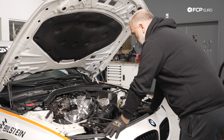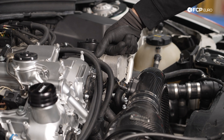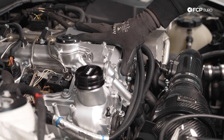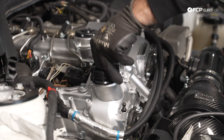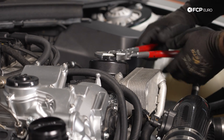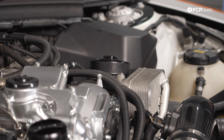The biggest thing here is that because this heat exchanger has both coolant and oil flowing through it, I want to reduce the mess in this engine bay as much as possible. So I'm going to drain the coolant and also do an oil change at the same time. This engine is fairly new to this car — it'll be the second oil change, so I'm expecting some debris in the oil filter from the rod bearings we put in. We'll drain coolant from the radiator and remove oil from the oil filter housing, which should prevent a huge mess.